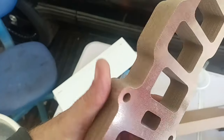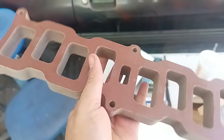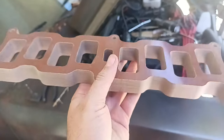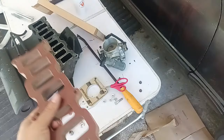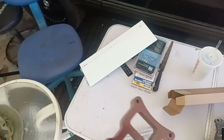Here's the spacer. Now this material is called phenolic — it is a special material that actually allows less heat transfer. Where it's aluminum to aluminum you get a lot of heat transfer, but this not only spaces it, it also stops a lot of the heat transfer from the hot lower intake to the upper and helps the upper from getting heat soaked. They also give you gaskets for top and bottom.